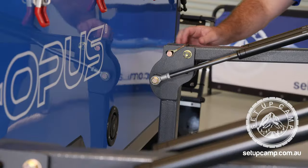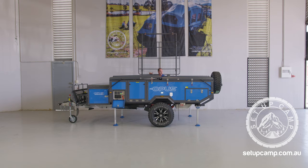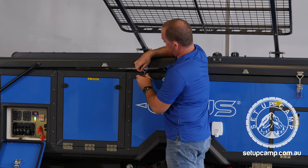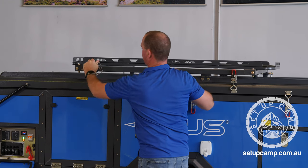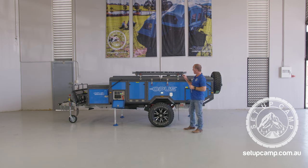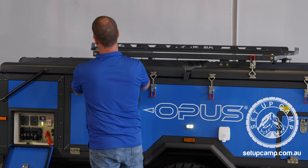While you're around this side of the camper, take the weight of the roof rack by pulling down and remove the two pins. Lower the roof rack back across the top of the camper. Coming back around the front, readjust this J-clip and latch it down, remembering your rule of thumb. Grab your roof cage, lowering it down and clipping it into position. One step that's going to save you a lot of heartache: this roof cage may feel like it clipped down tight, but you don't want to put a hundred kilos or more of weight on it and have those bump stops compressed. Just double check it is tight — get your body weight and drop it down to ensure those clips are going to stay clipped into position. Your pins come back through and are latched off.